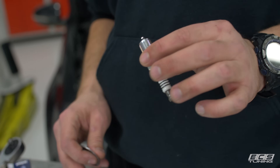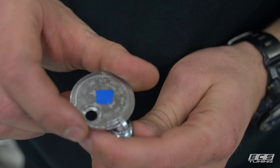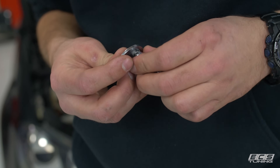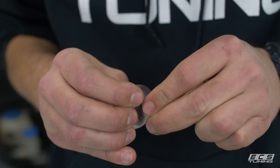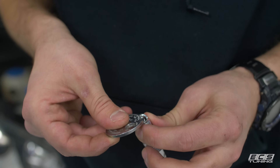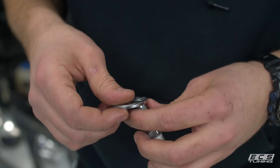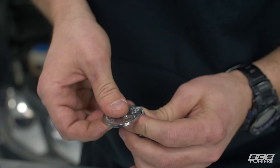These plugs are gapped from the factory — they're supposed to be at 31 thousandths, but you should always double check the factory gap to make sure it's right. Here we're only getting to about 27 and a half thousandths, and that's a pretty big difference as far as plug gap goes. So we're going to re-gap them. These are iridium plugs, so the electrode is really brittle, so you want to make sure you're only putting pressure on the ground strap. 31 thousandths will be a fine gap to run on a stock car up through stage two plus, but once you get up to anything significant like a K04 or otherwise, you're going to want to step that down to like 28 thousandths.